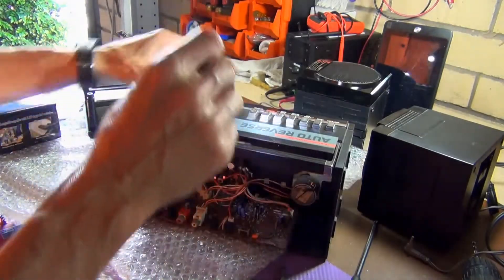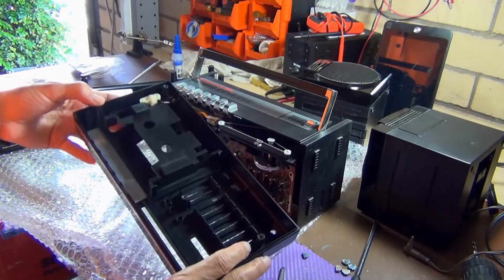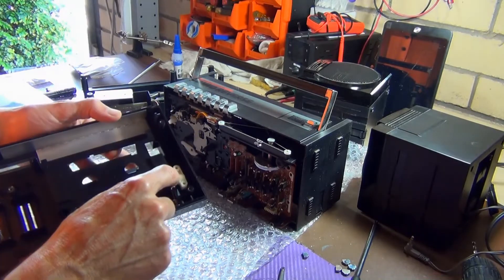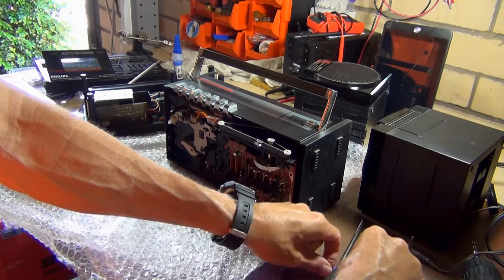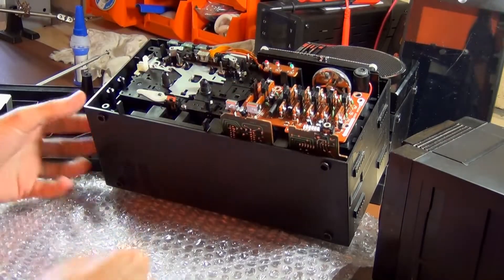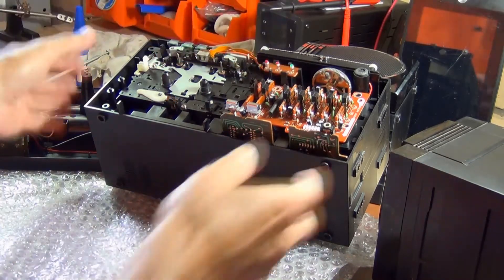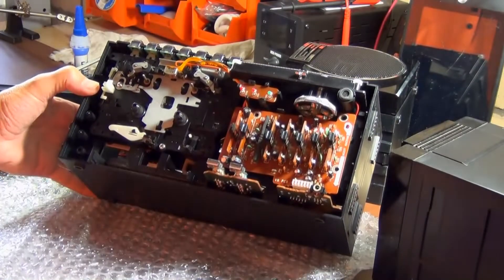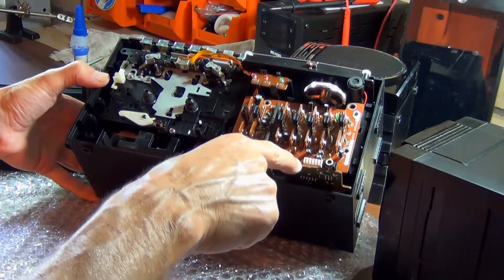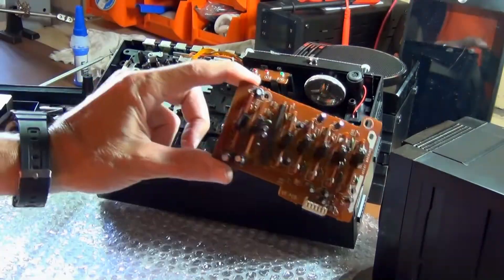If I remove a lot of these caps here, I should be able to get the front face off. Looking at the eject mechanism, that looks in pretty good condition — still got the grease on there. I don't like putting grease on plastic gears if I can avoid it. Front panel's off. First thing I need to look at is the mode switch, but I really need to get in there. There are little plastic latches — make sure you really look at what you're doing before pulling anything. There's a little metal header on a right angle connected here; once I click this off I should be able to wiggle it free. This one doesn't have any screws, so there's your EQ.